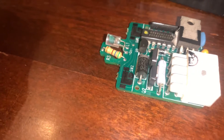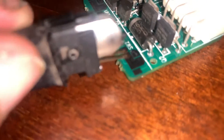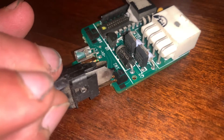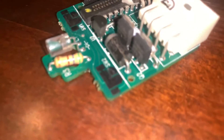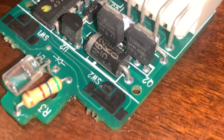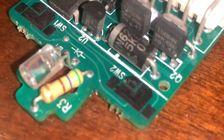I'm going to clean this part right here. The other thing you want to take a closer look at — these are the hard ones — that's where your copper piece touches. When you want to turn on your wiper blades, you push it in and it goes back. What's happening is you're connecting these two together. Taking a very close look, I do see a little bit of issues in this section right here — it looks like it's been rubbed. That's a possible issue.